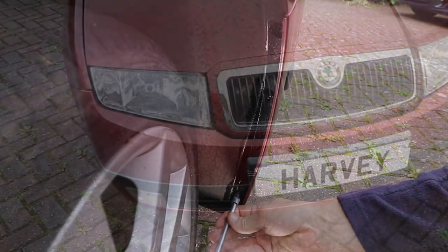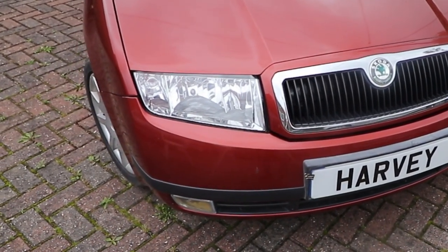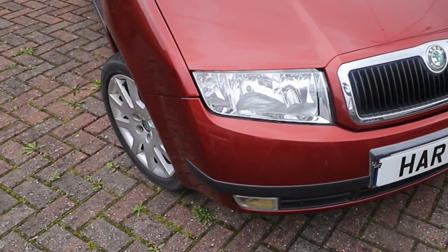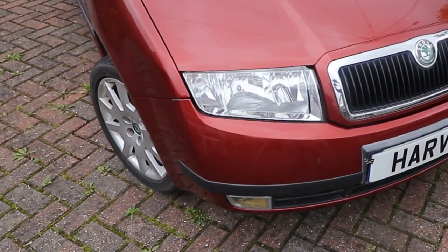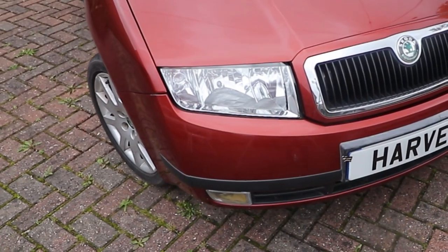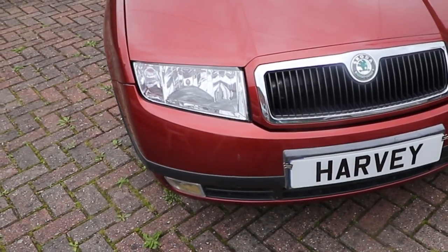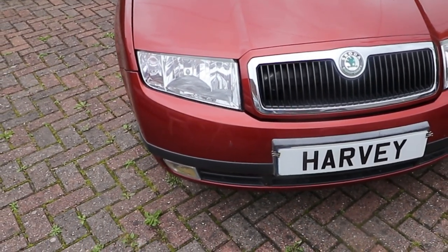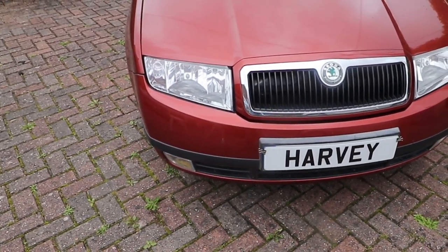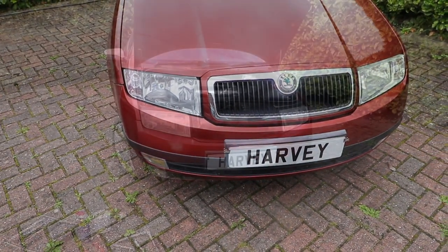Job's a good one. Once it's back and the adjusters are in the same place it should be fine, but a new unit will of course need its beam adjustment setting, and it's best to have this done at the local garage rather than attempt it yourself with a bit of chalk on a blank wall at five metres. I find that if you change out the headlights just before your annual MOT test, they'll probably do that at the same time for little cost or nothing. I'd always recommend getting this done correctly, as there's nothing more annoying than other motorists' headlights blinding you on the road — and it could even be fatal.